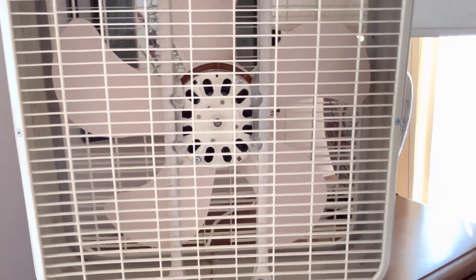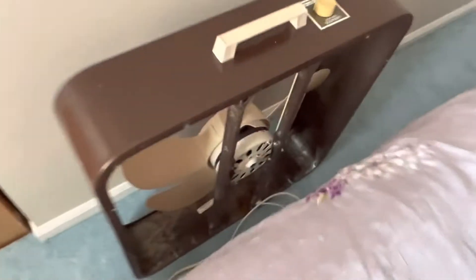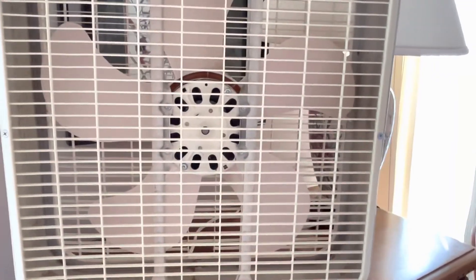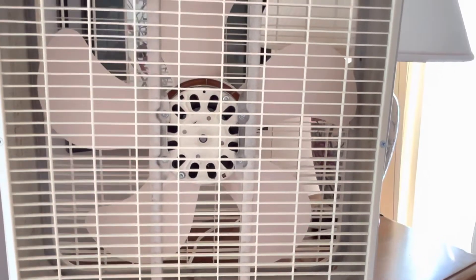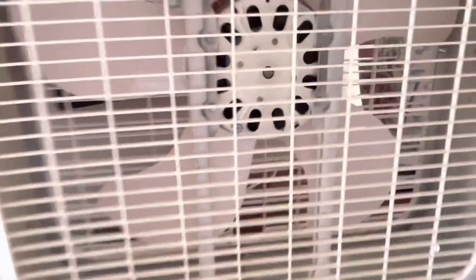All my other third gens have terrible relations with oil - I oiled my slash-M last week and ran it this weekend and it was already not great. Since this fan is oiled and running well, I'm leaving it that way and just added some oil to the existing oil so I don't lose that spin down. There also seems to be missing paint in some spots - it's not rust, it's just that the paint isn't fully there, like they only went over it once with the spray painter. Whoever painted this didn't do it right.